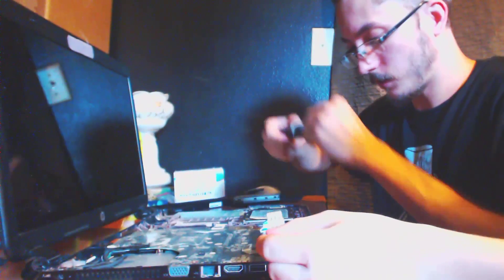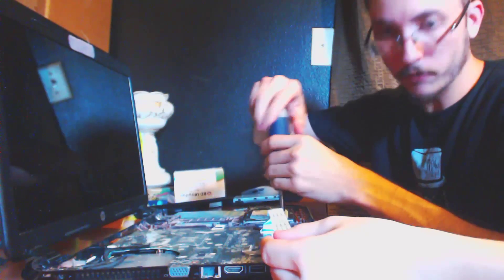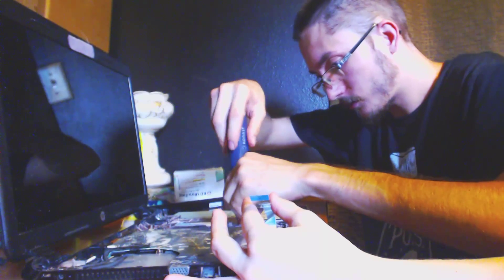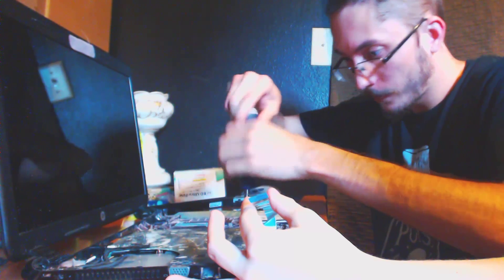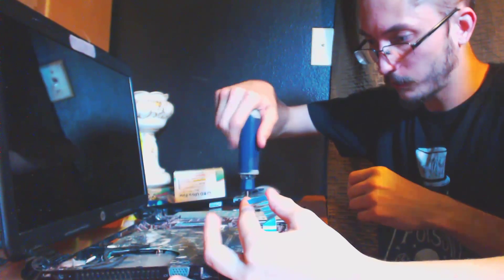The hard drive is not being rubbed up against the metal. You don't have to be macho man when you're putting in these screws — you don't have to tighten it down crazy. Because not only can you strip it, you can also ruin the computer, ruin the components that are underneath the screws, and ruin the screw itself. Just get it in there snug but not stripping it — give a couple turns after you get it all the way in and it should be good to go.